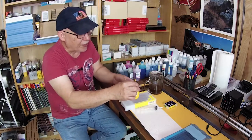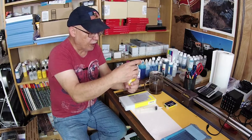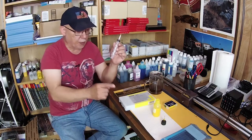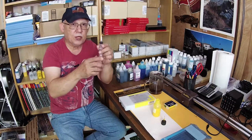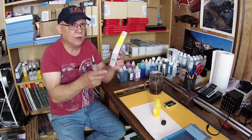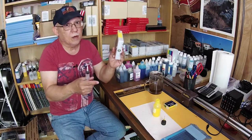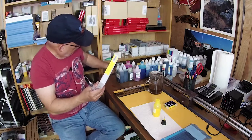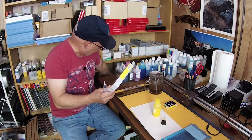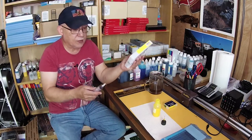The question was: how do you harvest these inks when you have access to the cartridges? You can use a plain-tip syringe, but it's a pain because the poppet valve will seal against the plain tip and you won't be able to extract ink — you'd have to twist laterally and risk harming the valve, especially if you want to reuse the cartridge. You can actually modify these cartridges and use them as refillables. I've done that with all my T-58s for the 3800 and 3880, and I refill them with OEM ink only.